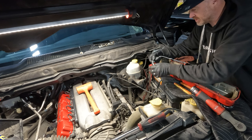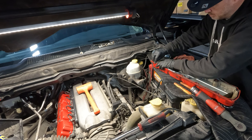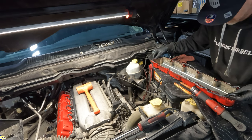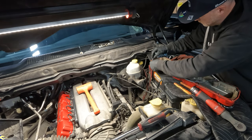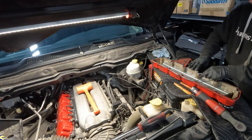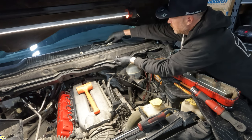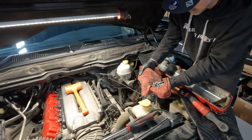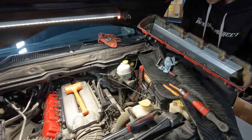If you're trying to figure out where the gasket starts, you can always look — there's usually some sort of indicator. In this case, there's this little dimple here, this little built-out spot, which is pretty much going to be your reference point as to where the gasket starts. I'm going to take all the hardware through the wire wheel real quick, get it cleaned up, and we'll be good to go. Got our hardware all finished running through the wire wheel and cleaned up, and got our valve cover all blown out with compressed air.